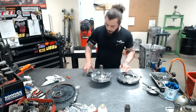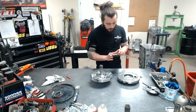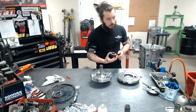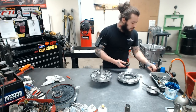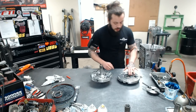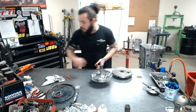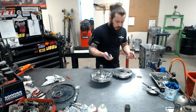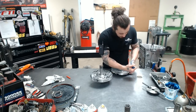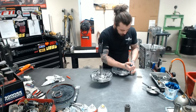So, in short, I have some pump parts here. And we have a guide washer that only goes on one way. Your guide rings. You're going to assemble this just like that. Place it down below. Then we have our slide spring, which needs to be, I pry it in with a screwdriver. It's the only way I know how to assemble it. Can be a little bit tricky.